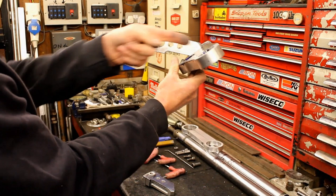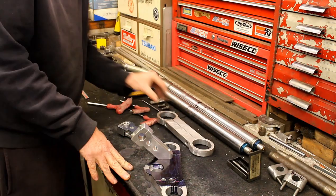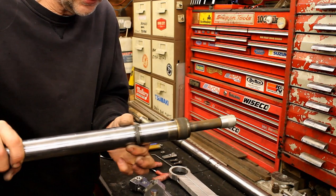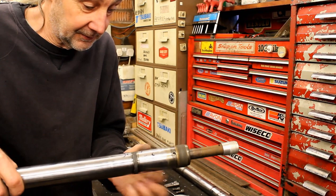The forks for the yokes are the ones seen previously. Something Jeff forgot to mention last time: he's now welded extensions onto the fork ends - actually extending the stanchions. The extension piece is from another set of yokes. He had a set of stanchions that were all pitted, so he cut the ends off. He machined a piece - inch and a half with a three-inch strip of tube inside - pressed together and then welded on.